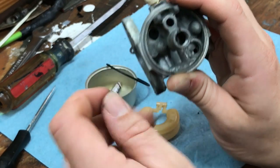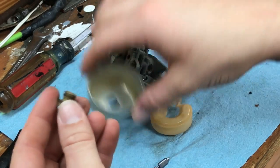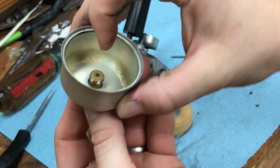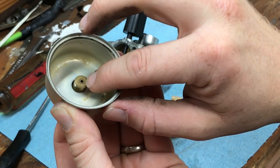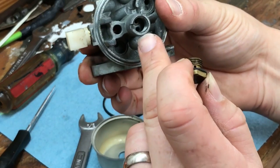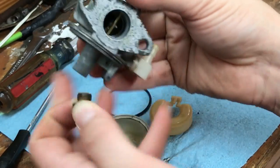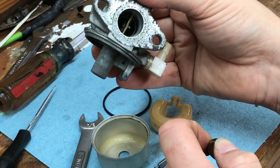The fuel comes into the carburetor bowl, and as fuel fills the bottom of the bowl, the bolt that has the main jet in it draws fuel through the bottom and up through the jet, which feeds into the center of the bottom of the carburetor. It's then drawn up into the throttle body and mixes with the air, which is drawn into your engine to make it run.